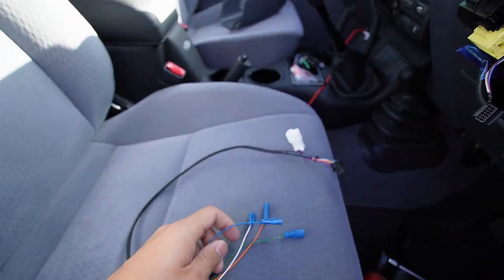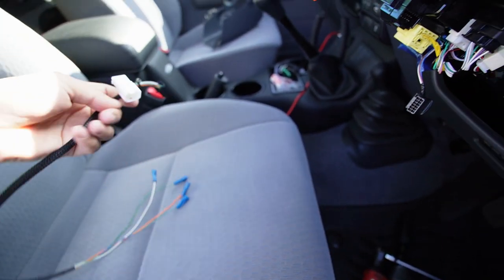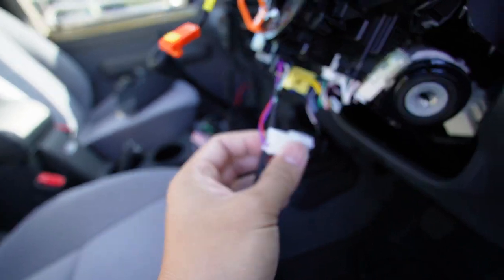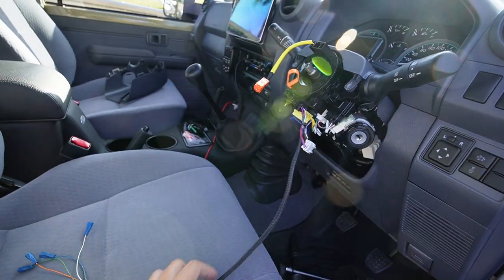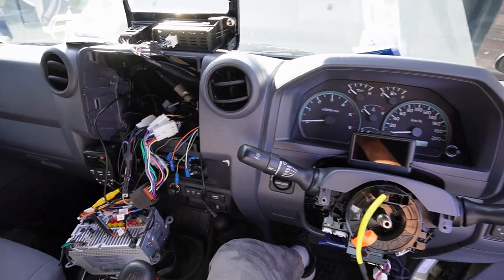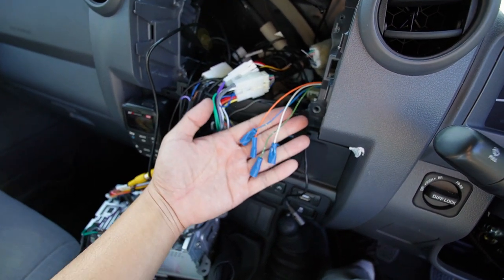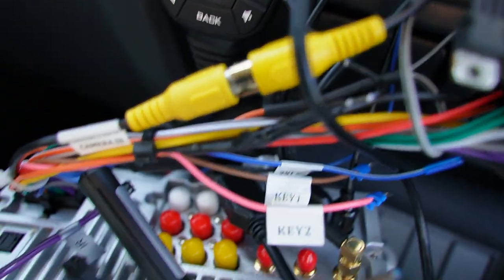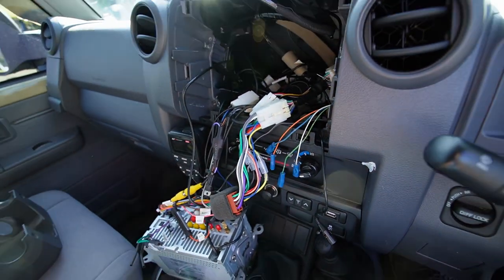Back into the car with our steering wheel control harness. I've added four extra spade terminals to make it a bit easier to plug in behind the head unit. I'm going to grab that connector from my harness, plug it into the upgraded clock spring, and this connector housing will go into the stock black connector. I haven't touched any of the factory wiring. This harness will go straight to my head unit. With the head unit removed, I've run the wiring harness up behind the dash and out behind the head unit — just those four wires. As a reminder, two of these are for key, one's for ground, and one's for illumination, and I'm going to get all those from my head unit. My head unit has both key one and key two wires, and I'm going to get ground and illumination from the patch lead for my head unit.